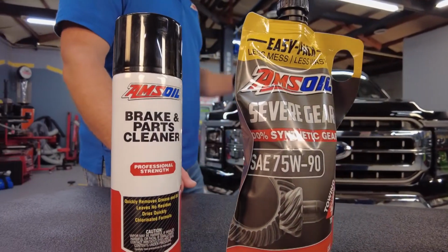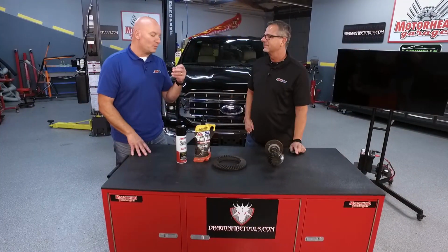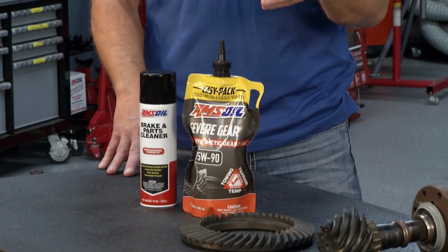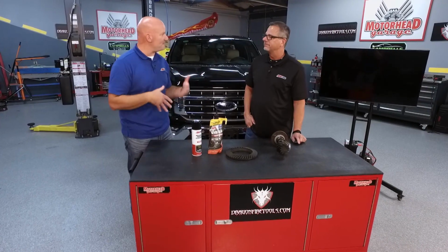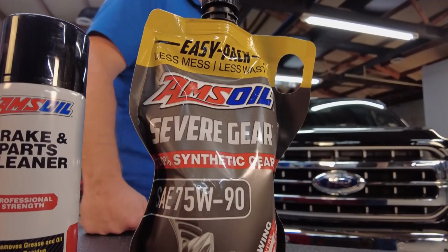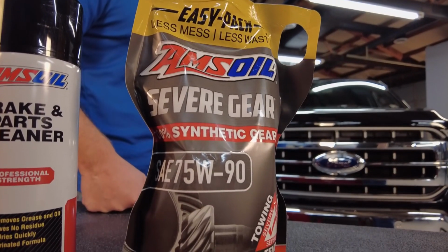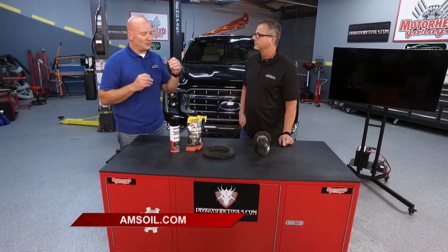Absolutely. The gear lube that's inside of that package, though, is also very, very special. What you described, all of those pressures and all of that action that happens inside of that gear, oil is jammed in between those gears. There's a lot of pressure, there's a lot of wiping that's happening. Proper additive formulation, good strong base oils, as you've heard me say before, they are highly, highly important. So you want to make sure you're using the right oil, making sure that all the gaskets are good, making sure you don't have any water intrusion or any of those things to make sure that you're protected.